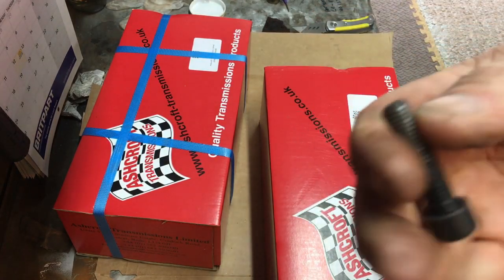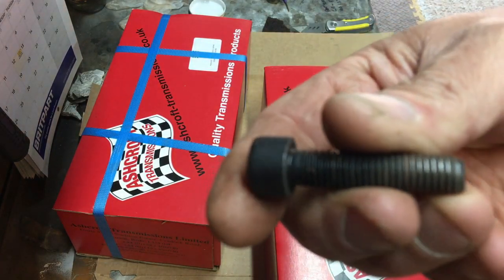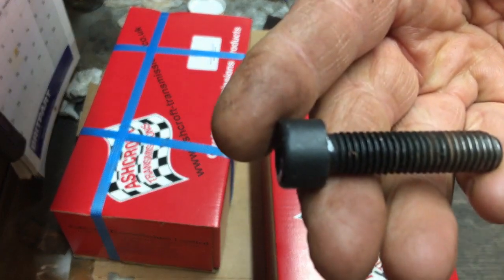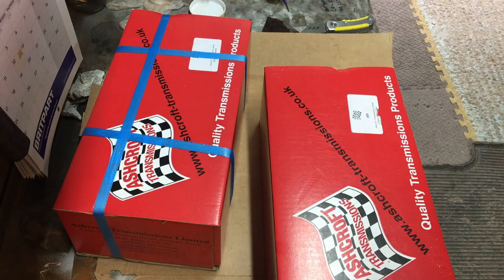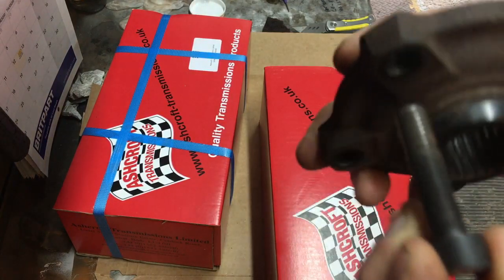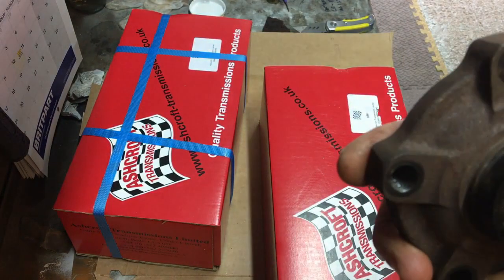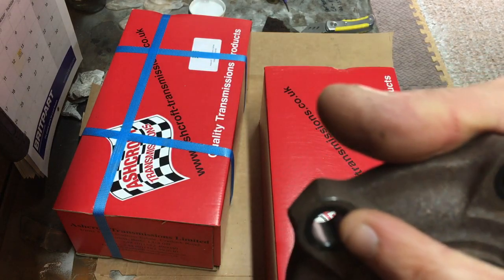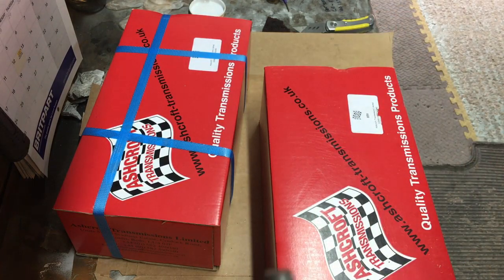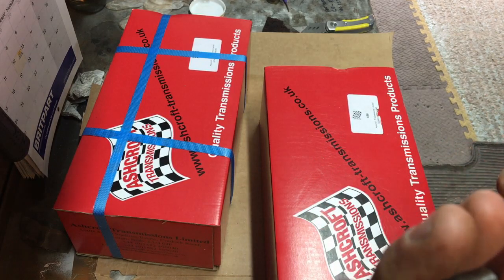This is what's known as an Allen screw or a socket head cap screw. You can see this one's got the thread all the way up. If you use a screw like this, what will happen is you'll actually be passing your torque through the threaded part. You've got a smooth diameter in the hole and you want that to be acting upon a smooth diameter on the bolt. So by all means use Allen bolts - socket head cap screws or whatever - but make sure they are a bolt and not a screw.